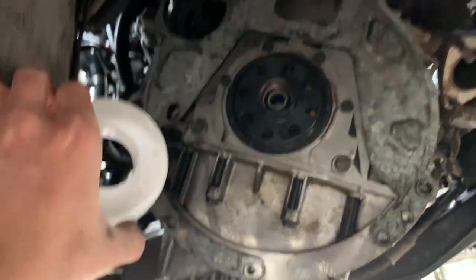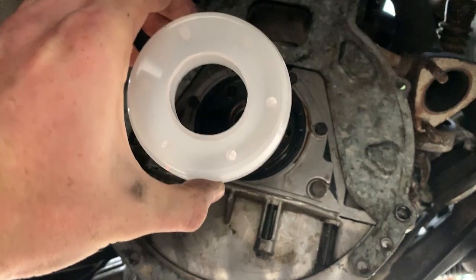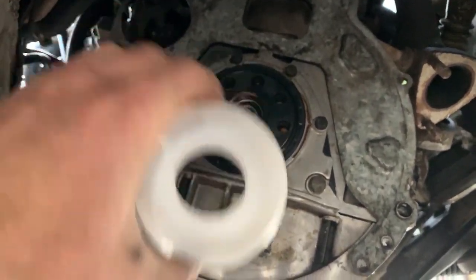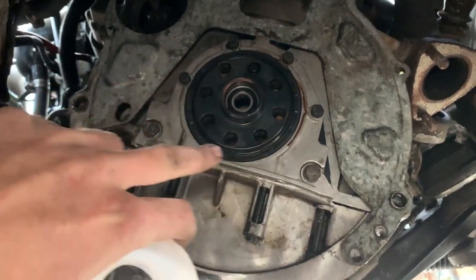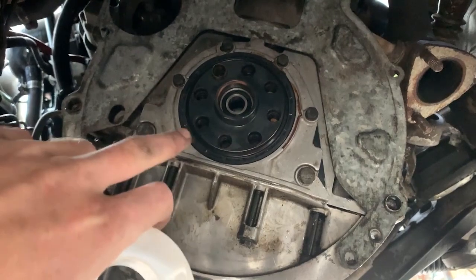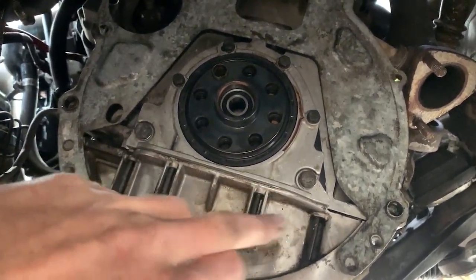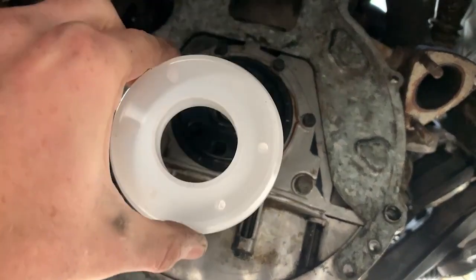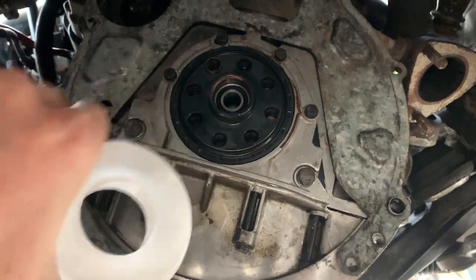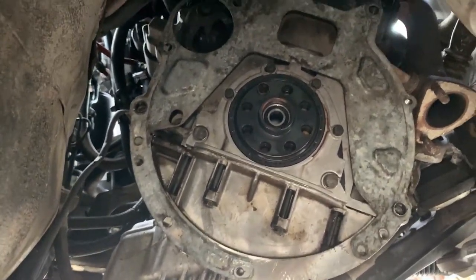So, taking this plate off, when installing the rear main seal, I put this in between it as well to install the seal correctly on this little aluminium plate. And then once we're putting it onto the crankshaft, a little bit of RTV at both of these corners there, and have this on there to guide the seal so it doesn't flip or anything. So it's all going well, it looks good, and yeah, ready to put this transmission back on.